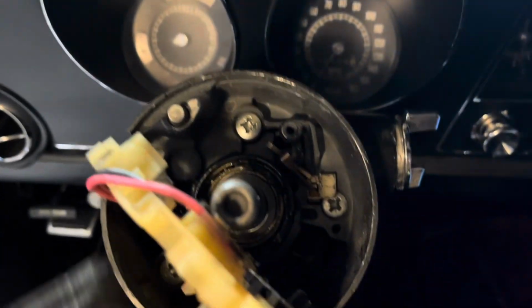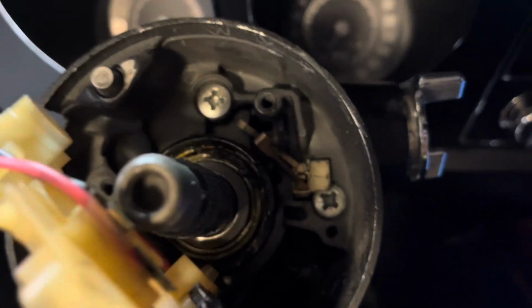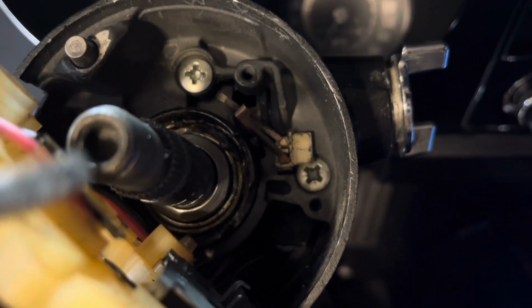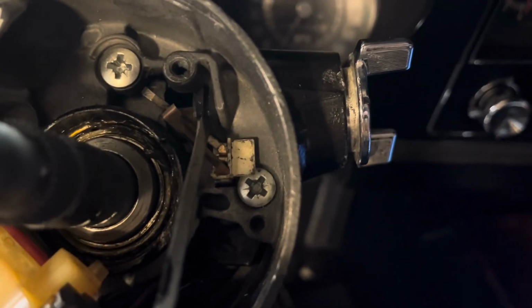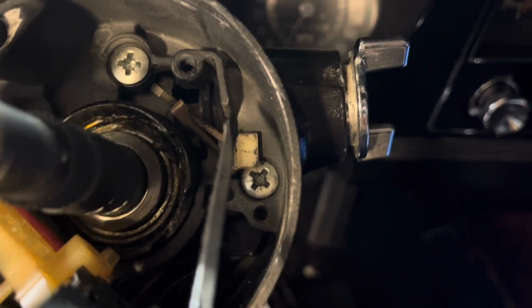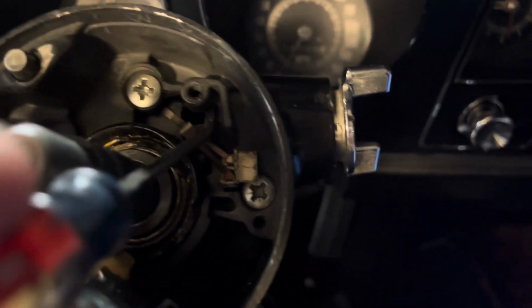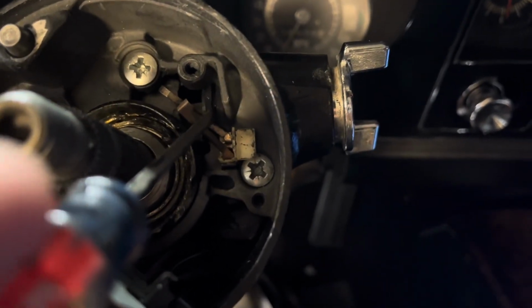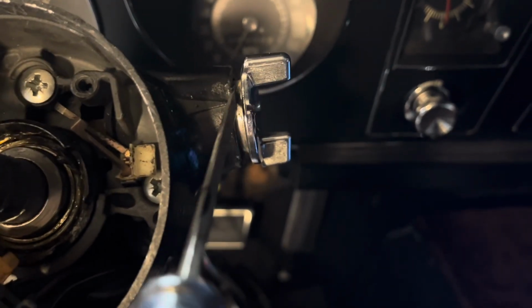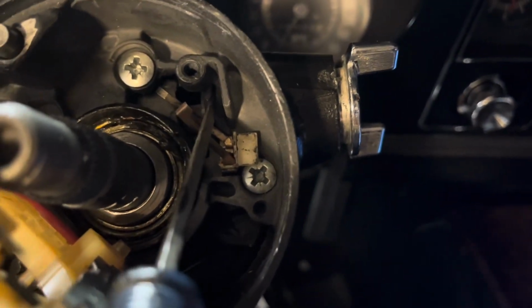Okay, there's a lot of confusion online about which hole in here you're gonna press in to let this ignition switch go. So I'm gonna try to narrow it down. It is really tough to see, but if you can look right here, there's a thin little slot. A lot of people think it's this bigger hole, or over here. It is that thin little slot. You push in there, and with a tiny screwdriver, you can feel it decompress the spring, and as you can see, it starts to pop out the ignition switch. So it is that tiny thin slot right there.